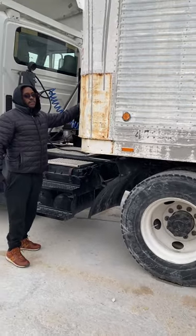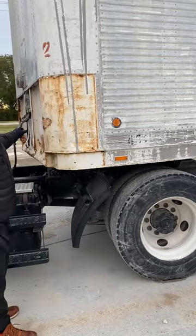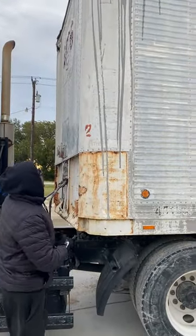So I got my bulkhead. Did I get all of the air lines and electrical lines in the last video? I got the bulkhead. Make sure it's not bent, broken, or cracked, properly mounted, and secured.